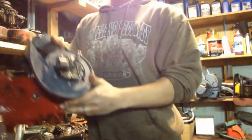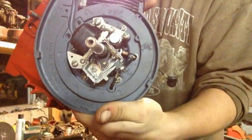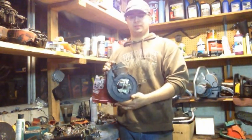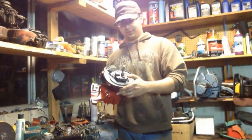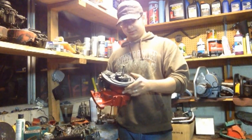So these are the points and coil set off of the 775. They're in great shape. These points and coil produced sparks, so I'm going to go ahead and use them. I filed the points a little bit, cleaned off a little bit of the corrosion, then reset them to 15 thousandths, and got everything tightened down.